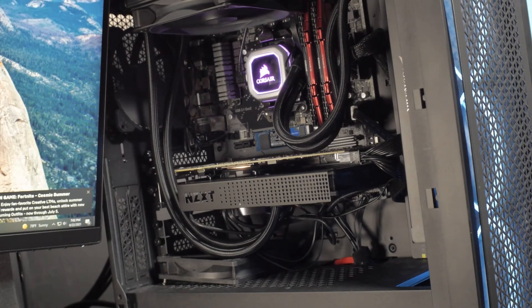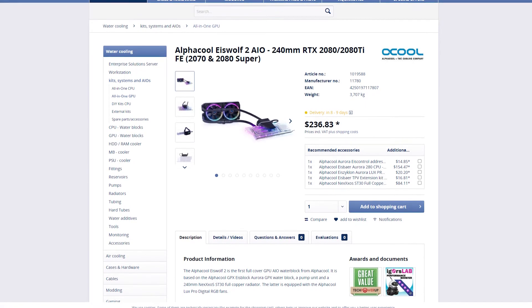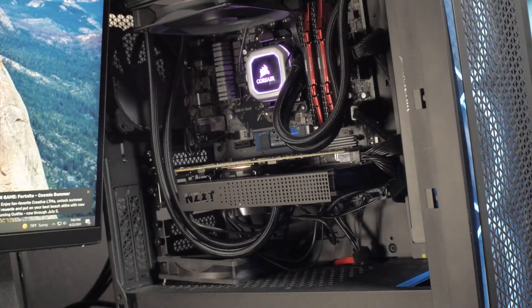I watched other videos on this and it seemed pretty easy going in, but after my card crashed three or four times it really scared me. Ultimately I got what I wanted, but if you have an expensive card like a 2080 Ti — even if you found one used at a decent deal and it's blower style and you really can't stand it — I'd look into a triple-fan aftermarket cooler instead. I also saw an AIO with a water block combined that I'd be down for, but I couldn't find US availability. For now I'm sticking with this. I've been testing it over the last few days, leaving games running for hours in the background, and it hasn't crashed.